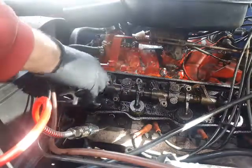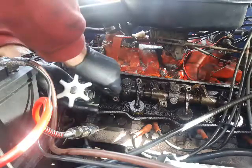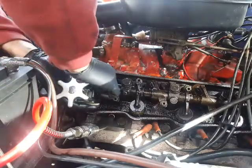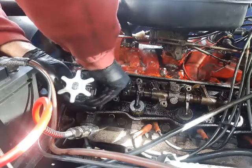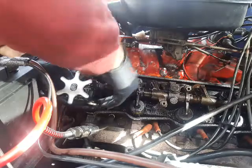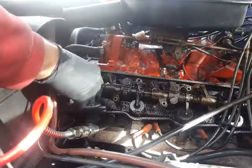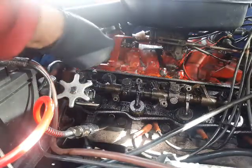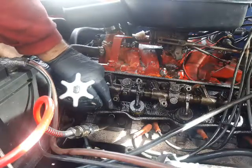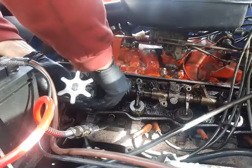So, and then if you change it, put the compressed spring on it, placing the retainers carefully, not losing them until they are sitting. So I think I get too much pressure, so I have to switch on the compressor. So the retainer goes down here and back in place. Sometimes a little bit tricky, but you will manage it.